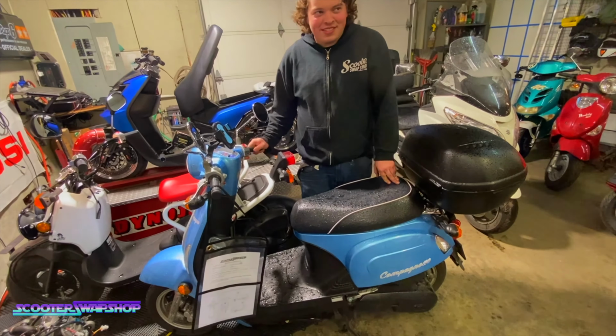See, it's just loading up because that bowl's overflowing. You can typically reach down, shut the gas off. They typically clear up a little bit, lowering the level of fuel in that bowl. I'm gonna go back and drop the pilot down one size. The bowl's not leaking right now, but I just feel like the pilot should be bigger. It's like this pipe wants a really lean pilot, which just seems odd.